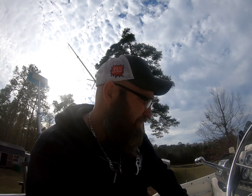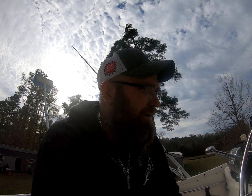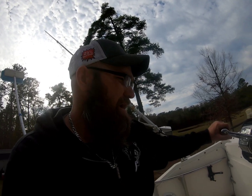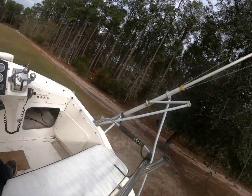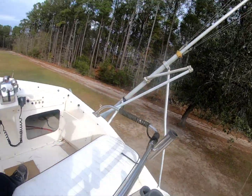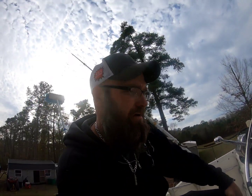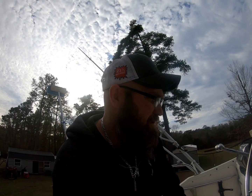And you figure with these motors, when they're in the water for going in and out of gear, they're probably gonna run about 900 to 1,000 RPM, something like that, to keep them from stalling out. You can see, clutch in gear, shaft spinning, sounds beautiful. I'll take her out of gear. Yeah, she's running good. The other motor runs perfect, sounds perfect.